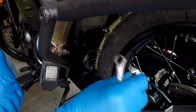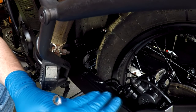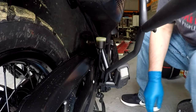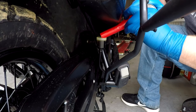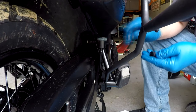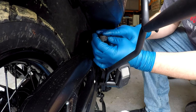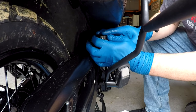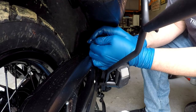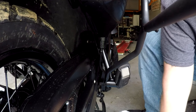Alright, that's closed. Put the rubber back on. Don't worry about brake fluid if you do spill some — wash it off with some soapy water, rinse it off and it'll be gone. It won't ruin your paint. Last thing you're gonna do is top off the rear master cylinder, then make sure you got a good pedal. Put the rubbers back in and then put your cover on. On the BMW F650 it does call for DOT 4 brake fluid — I'll put a link to it in the description for you. Don't over-tighten that cover, there's no need.